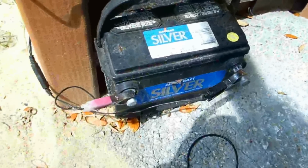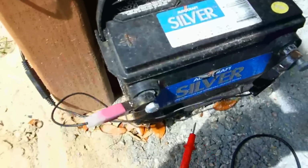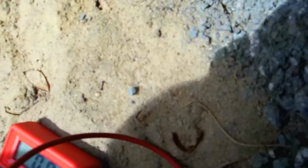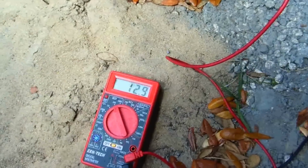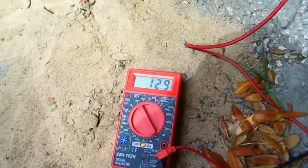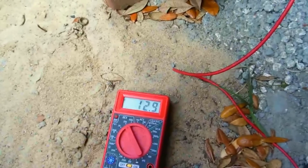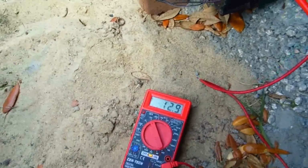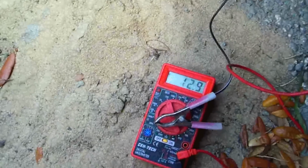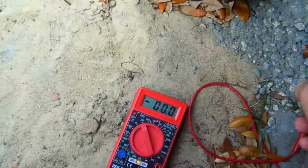Just like what I have on the Jeep, if I'm storing this battery a long time, and I put the voltage meter on it, you'll notice that the battery voltage is showing 12.913 volts. A full charge battery is 12.7, 12.65. So if you take this meter off, it'll drop down a little bit. So it's actually putting a charge into it right now.